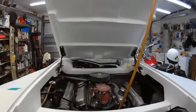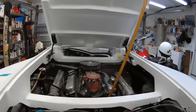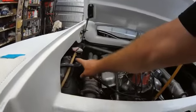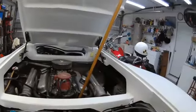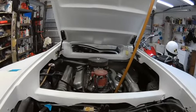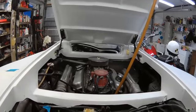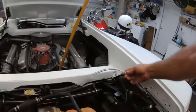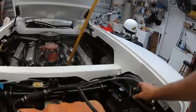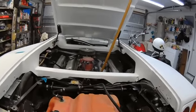Well, the vacuuming down of the system - it never made it to twenty-three pounds, it made it just over fifteen or so. And the second time around didn't even climb over seven to ten. I'm not sure what's going on. But the water level is full and it's staying there. So there may still be some air in the system - I'm going to go ahead and start the motor. I know that the thermostat will open up, so I'll just let it get up to about 180 degrees, wait for that to open up, and then see if it purges itself. I'm still anxious to see what happens with these lines. Once this thing gets up to pressure it's going to be interesting to see if it ultimately burps itself and gets all that air out. So let's push it outside and fire it up.